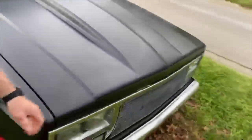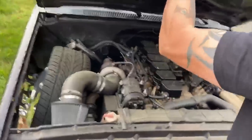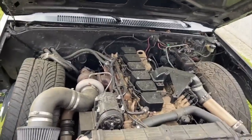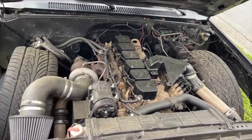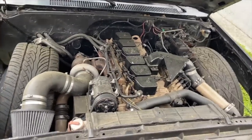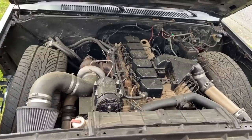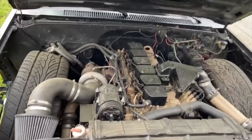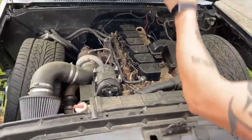It's got a 12 valve Cummins with a 360 trans shoehorned in there. It and the 24s, they don't allow for a whole lot of room. Future upgrades, I'd like to swap out the front cross member, put in a GSI cross member, get rid of that nasty ugly camber, stand the wheels up, put some fender wells in it, and of course hook up the AC. And, you know, make it look pretty.